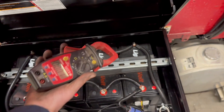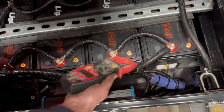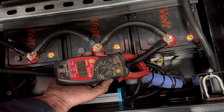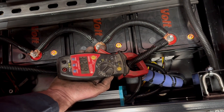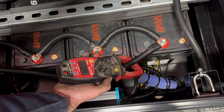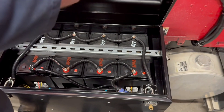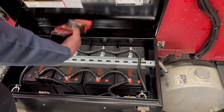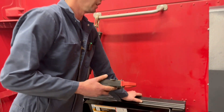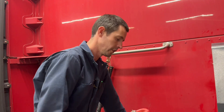Before we go up to the inside, I've got my clamp meter here for DC amps — we're going to check where our draw is at. Right now we are pulling just over 20 amps of power. It's not really hot in here right now, but it's continuous 20 amps at this point running continuously. With heat and as the compressor works harder, it's going to draw more amperage. Each battery is 100 amp hours, so four batteries equals 400 amp hours. Theoretically at this amperage draw, this unit would run 20 hours continuously, but once it gets hotter we're going to go up to 30, maybe 40 amps.